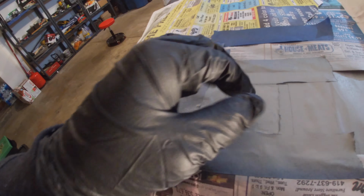This right here. This stuff works great, and it's actually relatively cheap. If you unscrew the cap, it's like nail polish. It's a brush. What we're going to do with our caps is take some fine grit sandpaper and just lightly sand the tops. Then we're going to hit it with some touch up and let it dry before we put it on the car or anything like that.